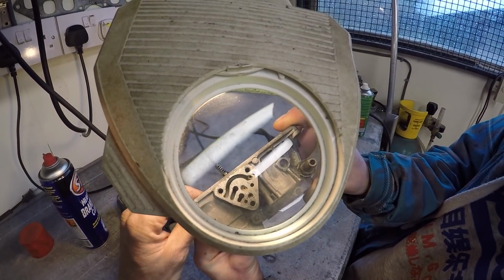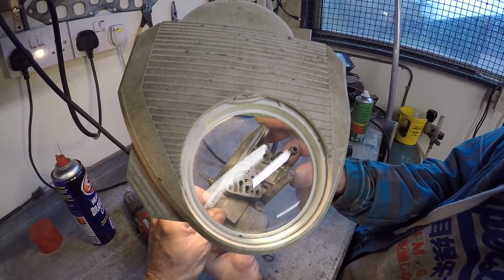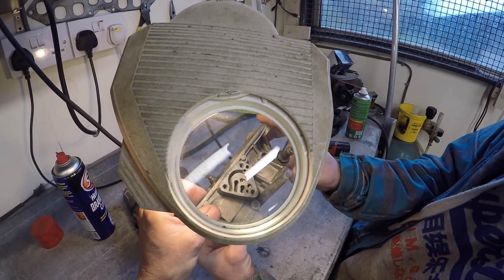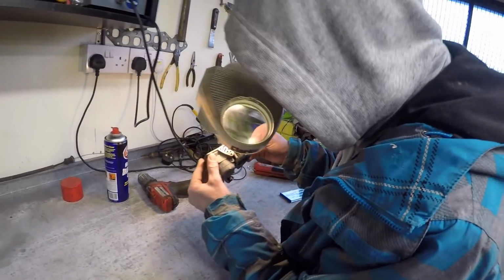So as you can see, well, I don't know if you can see, actually. Bit awkward, isn't it, through that magnifying glass. Well, that's drilled out where it steps down 1.3 mil. That should be right, that, for loads of boost, mate. Yeah, boost. We like boost.